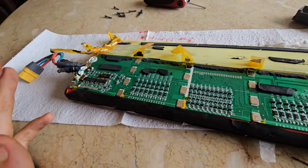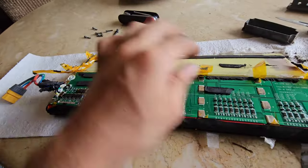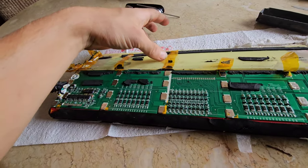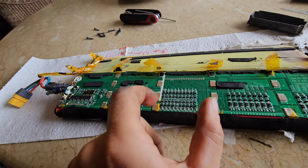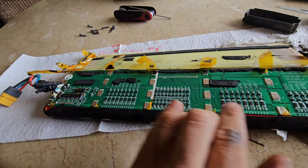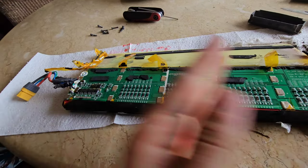The BMS - I don't think it's fried. I'll check it again and make sure there's none that are particularly low because it's most likely discharged it unevenly. So there'll be one set that's lower than the others and I'll have to try to charge those up individually to bring the whole pack up to normal, and then it should be good.